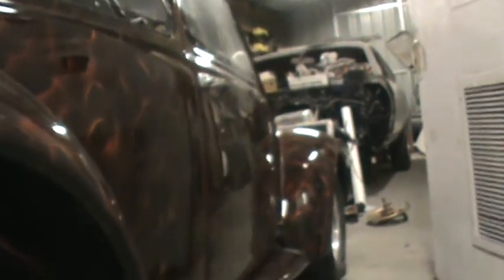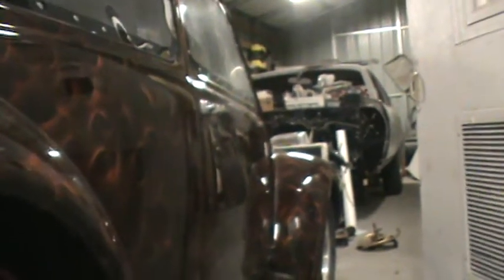I know on some of the 10.5 cars, it was starting to lift the car off the ground. The pressure from the pipe, when they had them down on the ground, or if it was coming out of the side of the car pointing over onto the guardrail or the wall, it was driving the car over the center line. So a lot of the guys started putting the pipe straight up in the air. They look like bullhorns now. If you see them, they're coming out of the fender and they point straight up or towards the back of the car. And that's why.